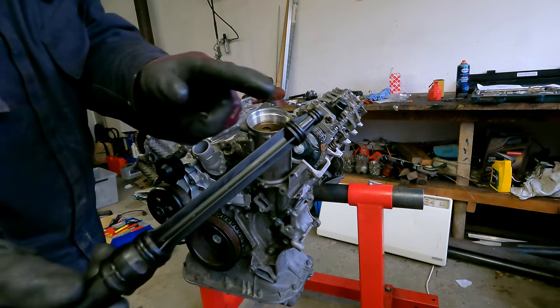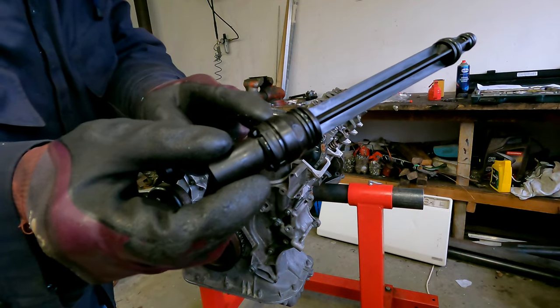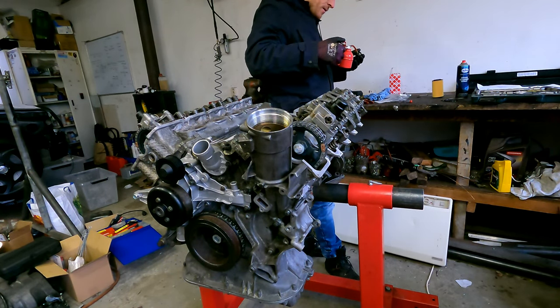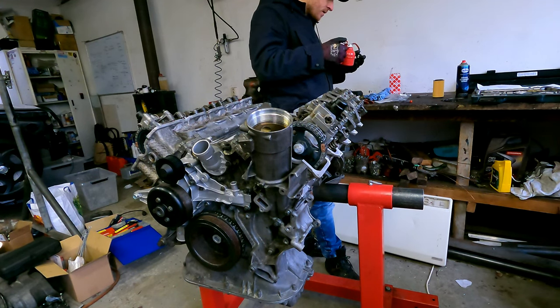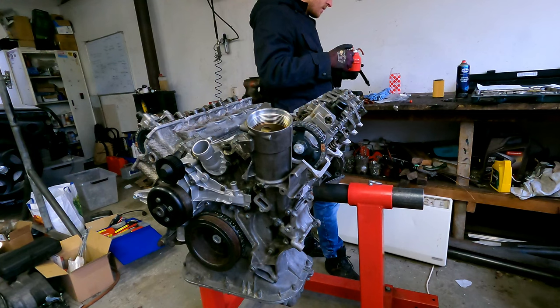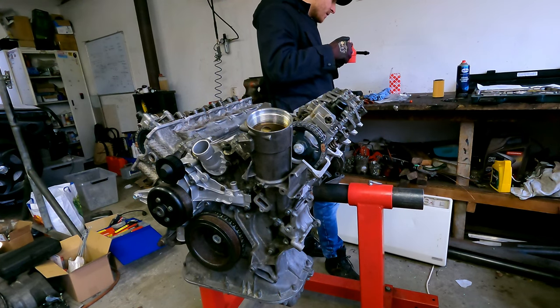Pipe needs to go in. There's three O-rings. Goes from small to big. Here's one, another one, and another one. They were in my filter kit. So the one underneath the housing I bought at Mercedes, and this was in the filter kit. So I'm oiling these O-rings so they will not get damaged. The old ones were very hard, so it's pretty good to change them.